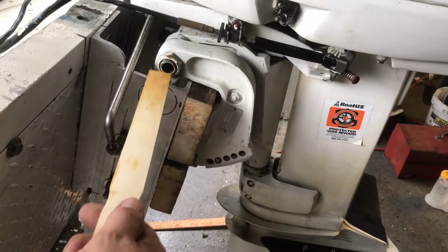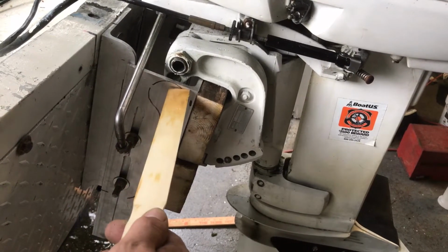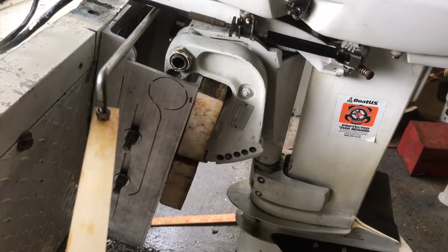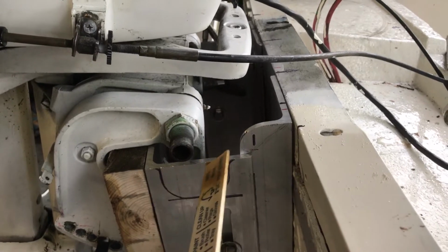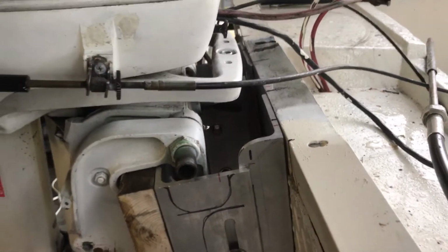This is where the end of the steering cable rod comes out. I'm just going to cut a little bit of that down right there. So if I had to get a wrench or something in there, I don't have to fight with this being in the way underneath, and just in case for any other clearance of that coming through. On the other side, I'm going to do the same thing. I'm just going to notch below there. I'm just going to do maybe a 1/2 inch notch down, just so the nut can fit and not catch on the aluminum. But that's it.